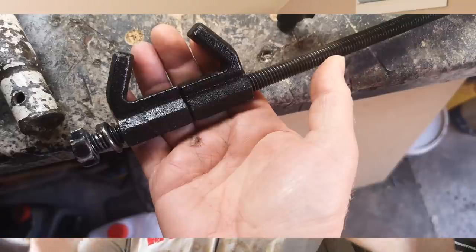While we're here, let me tell you a little story about stupid Steve. See the palm of my hand — there's a nice little cut on it. Ethan Minever, who's got a BMW 1 Series, had his spring snap and it went down the strut shaft, wedged between the wheel while the car was on the drive. We had to repair it on the side of the road. While trying to get the new spring on with a spring compressor, it popped off. I was using an impact gun on the spring compressor. It wasn't quite fully closed — about that much gap between the two pieces — so I put the gun on it held in the palm of my hand to release the thread down the shaft, but my gun was set to tighten. It tightened and pinched my skin in between. I've been a cripple for a couple of days, but I'll man up.